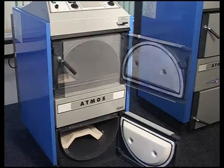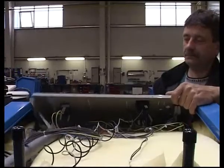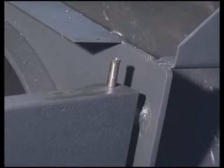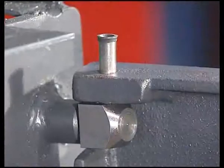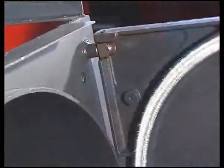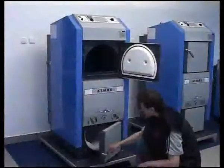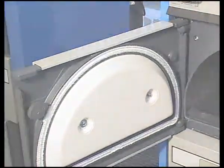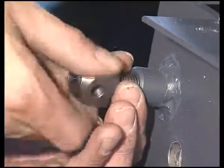If we need to replace the doors or to adjust the position of the hinges, we have to remove them. It is necessary to remove or at least lift the control panel. After releasing the panel, we knock out the hinge pins and remove the door. By moving the hinges to the left or right, we adjust them to the required position. If the hinges are set correctly, we install and secure the door with the pins. In the same way, we can change the door opening from right to left by moving the top door to the bottom position and the bottom door to the top. This interchange is possible because of welded hinge nuts on both sides of the frame.